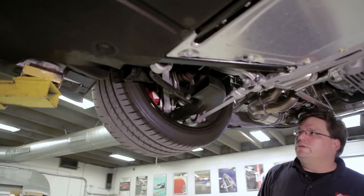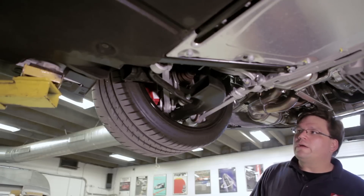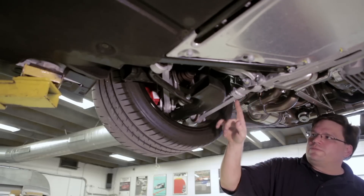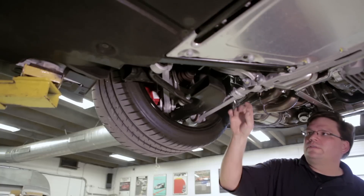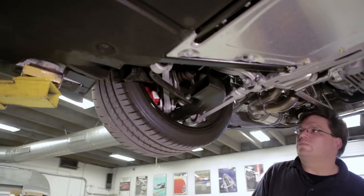As we focus in on the nuances of the right rear suspension, we can see some carryovers as well as natural evolution in parts and components. The control arm in the back, which aligns for toe as well as camber — they've always used shims on GT3s, and you can see that same principle still applies on this car.